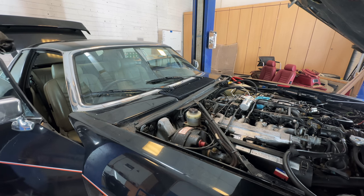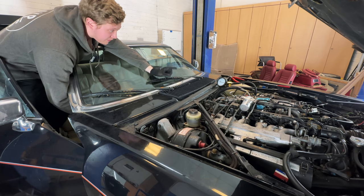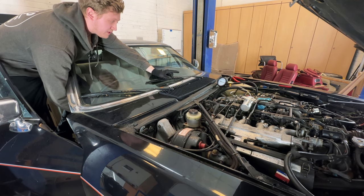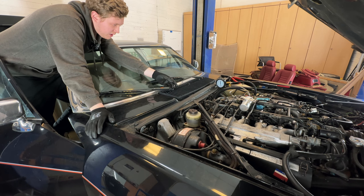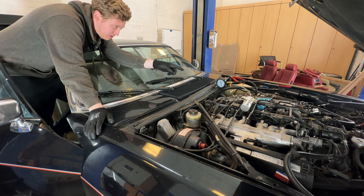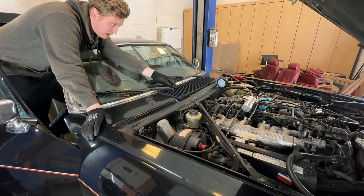So now that I've got the fuel pressure gauge on, I'm going to get in the car, turn the key with the fuel pressure relay in. Oh, it is spurting fuel - that is not good. I'm looking for the gauge to stay around the 40 to 50 mark. 40 - there you go. Fuel pump's fine. Then I had to cut into this line coming into the rail. On these cars I don't have a Schrader valve, so you had to cut into it and then put your own little one in.